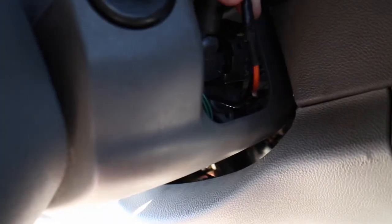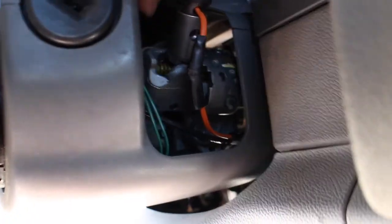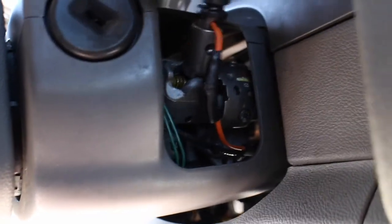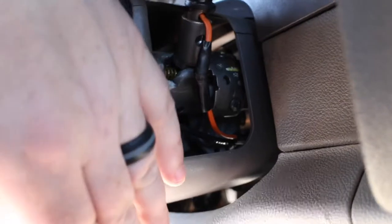As you can see I have already fixed mine. The problem with these wires is whenever we shift, the wire itself is so loose that it gets caught in between these grooves right here. As you do that over and over again going down all the way into drive, reverse, whatever gear you have to be in, it eats that wire away. And then once you finally hit it, it'll make connection and it'll turn your tow button on. So for you guys having a big deal with this and about ready to jerk the column out — pop the boot off, look at the wire. I promise you it's naked somewhere, it's chipped somewhere, the connection is not great. Check it and that will fix it for you guys.